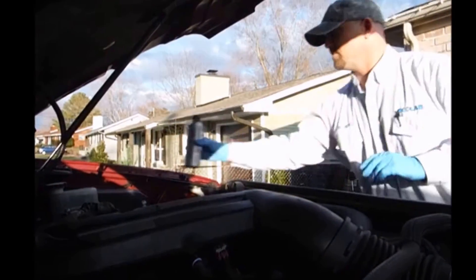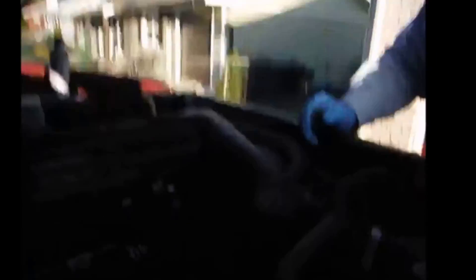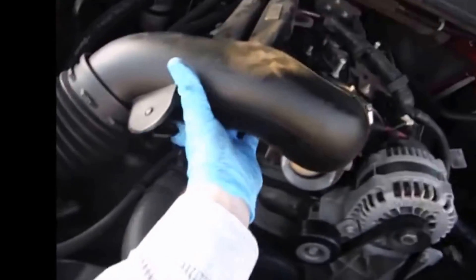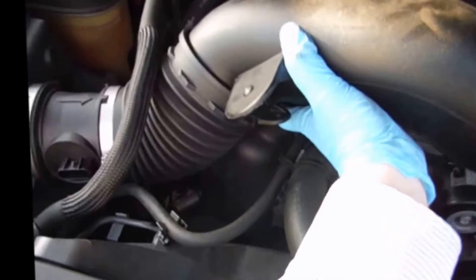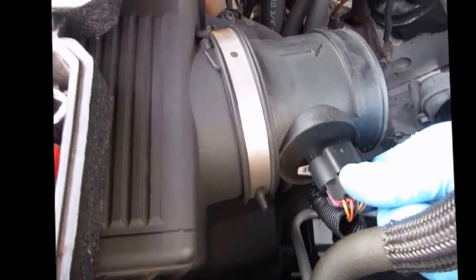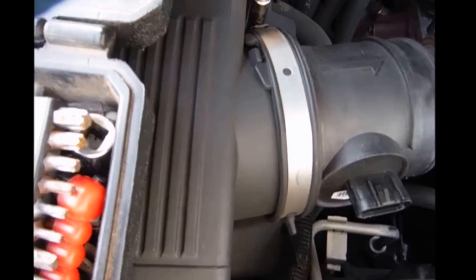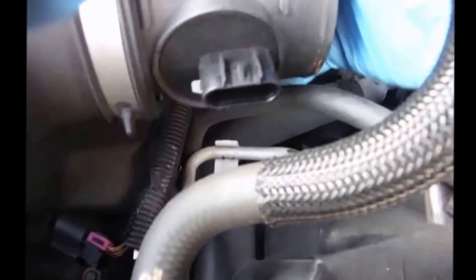You should be able to pull this up and out. There's a little clip right here on your radiator hose — you just got to separate that, just like so. And then this whole thing just lifts right up out of here. Now, if you're going to clean your mass airflow sensor too, you just squeeze this tab and pull that plug out. We've got this clamp to take loose, and you don't have to take these clamps all the way off — you just have to loosen them up. The mass airflow sensor should slide right out.